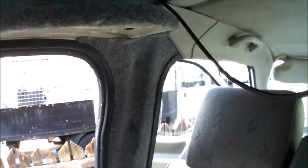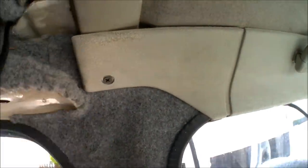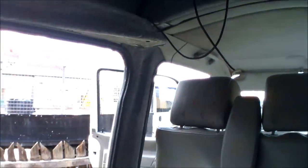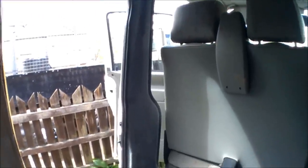That's the pillar all finished and carpeted - I just need to put the seatbelt stuff back on again. That's tucked up behind the rubber seals. I've peeled both of the rubber strips off either side just to go all the way down, so the carpet runs up into the seal - so there shouldn't be any water getting anywhere near the carpet. Now I've just got to put the seatbelt stuff back on: the main bracket at the top first, then cut the hole out for the mechanism at the bottom, bolt those on, and that's it. That's the seatbelt pillars pretty much done.